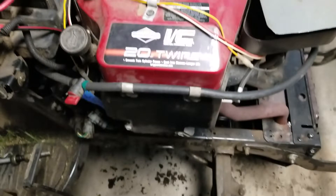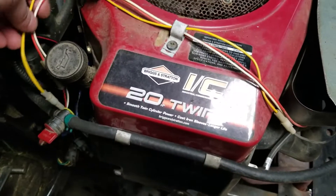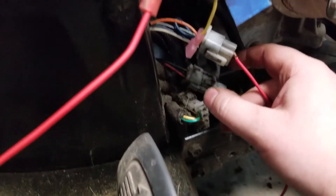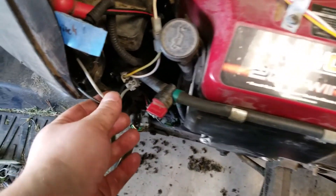Mongo have the hood bracket, heat shield, and old exhaust - fits good. Hood will attach. Just need to see if it's wide enough - she's wide. Also, Mongo get fuel lining. So take this fuel line and shut-off valve from the other mower. Route it real nice back there - real nice, hose is comfy. Good to have a comfy hose. Fuel hose clear of chafing, burning, and binding. Only thing left - Mongo figures out electrical. Let's see if it runs. It's alive! Wiring works - got all wired in, got kill switch in, got magneto stuff on.